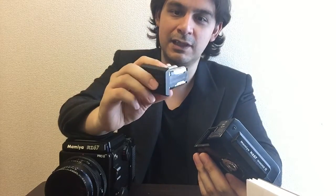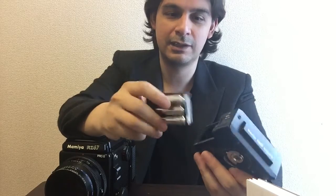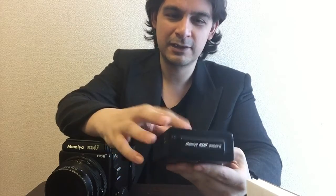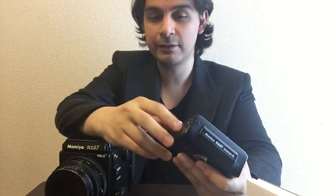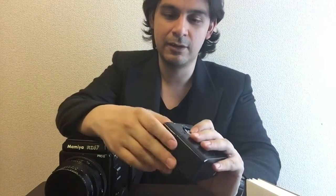When I replace the batteries I'm not going to check which ones still have charge — I'll just replace all of them. If you see performance getting a little slower, just replace all the batteries. If you mix batteries, it may demand too much from one battery and try to put energy back into another, which may cause leakage inside and damage the unit. So be sure to replace all batteries at the same time.